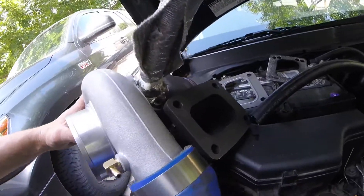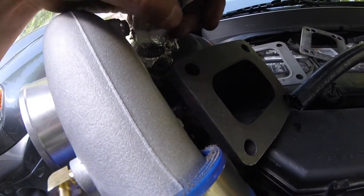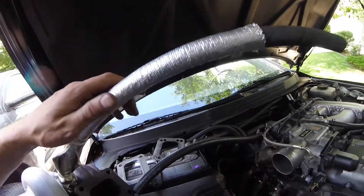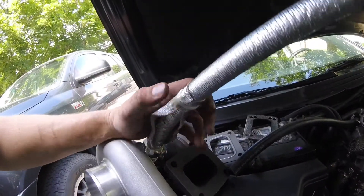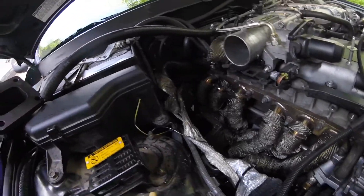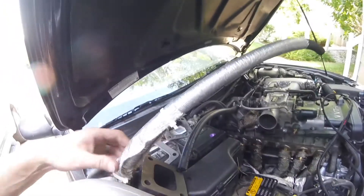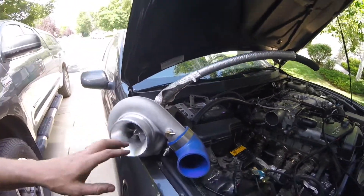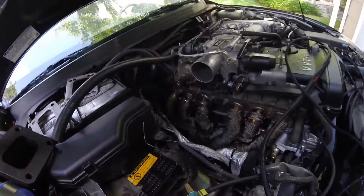Here is the new turbo drain line. I have that firmly fitted up to the turbo. I have the turbo wrapped and the line wrapped as well. I have an additional piece on - I know these zip ties are just going to melt off, but I just want this extra piece that's going to be kind of sitting on top of the manifold there just to have a little extra protection. I'm going to go ahead and put this down in there and begin the task of bolting it in place.